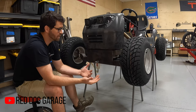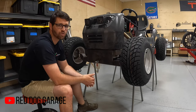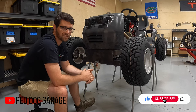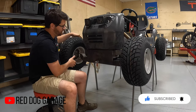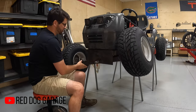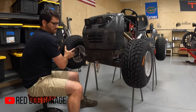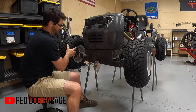I did go through several design iterations — one of which I had independent front suspension, which would have been cool — but for this width, this size wheel, and the amount of space I had to work with, it was just not working out for the time being. So maybe down the line that will happen, but for now we've got a solid front axle with pretty good articulation and the wheels turning connected together through the steering. I'm pretty happy with how this came out and I think it's pretty solid.